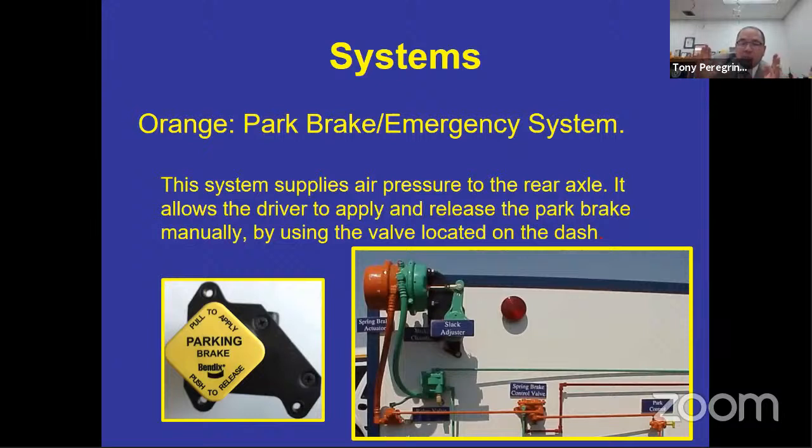So in order to move the vehicle, you got to push in the parking brake. And in pushing in the parking brake, you're going to hear a psh, that air goes into the rear of the bus to the rear brake canister, this canister right in there, and it compresses the spring. Now, if you see this rod right here, we call that a push rod, that rod would push in because there's no more spring expanding it. So it pushes it in, therefore moving the push rod, moving the slack adjuster, and disengaging the brake. So allowing you to drive the vehicle